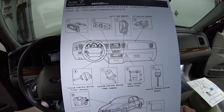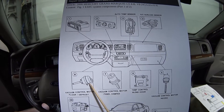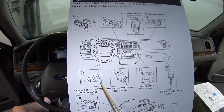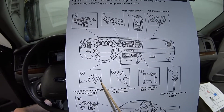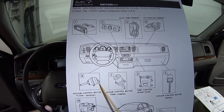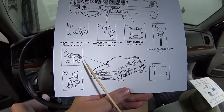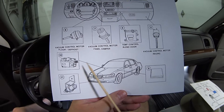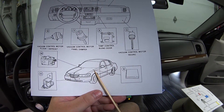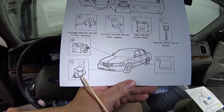The recirculation motor is behind the glove box next to the blower motor. In bad wolf's case, it's possible this motor could have a rupture and is having a problem maintaining or pulling vacuum so that it can pull that door and shut off everything else to force air through the defrost vents. The second place you'd want to check is the vacuum source - check the vacuum lines to see if any are pinched, kinked, or ruptured, using a vacuum gauge. This right here is the vacuum tank, which is under the hood on the driver's side in front of the wheel, and it runs these three vacuum control motors.